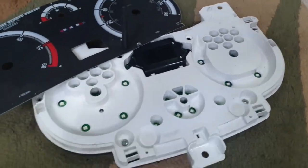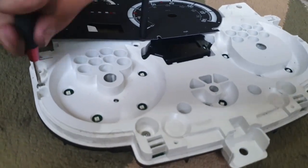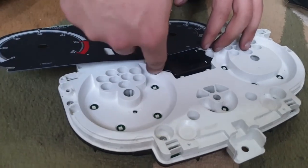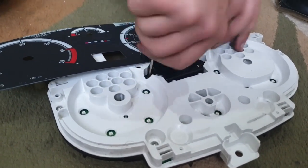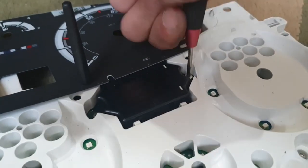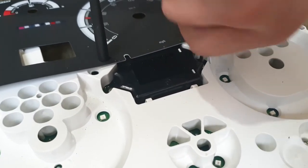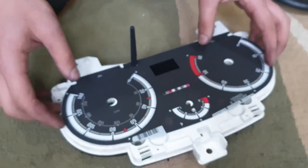One thing to make sure here is that you put the two screws around the screen back on properly — make sure they're not even loose. If you miss them or if they're loose, the screen won't be fully touching, the connections aren't going to be clean, and that will cause the digits on the display to be distorted and not clear when you start the car. After that, rotate the black plate back on and press down all around it to make sure it's all clean.